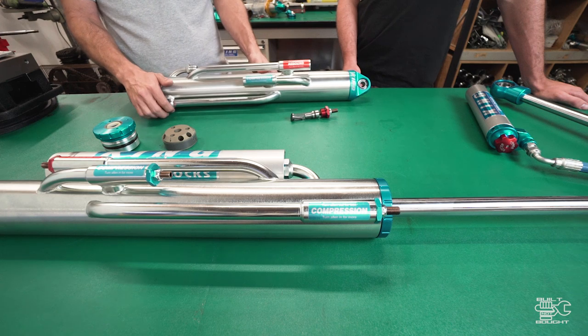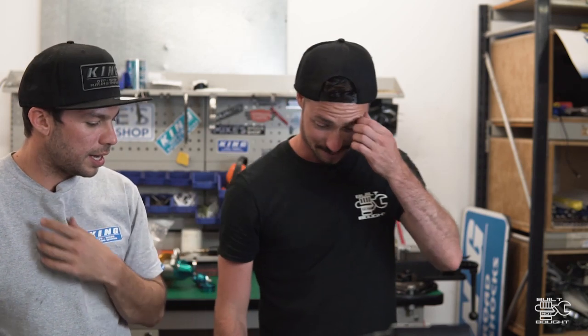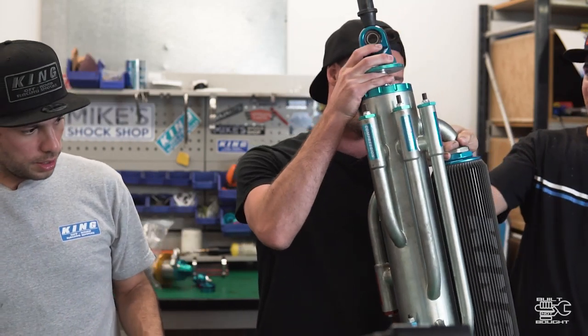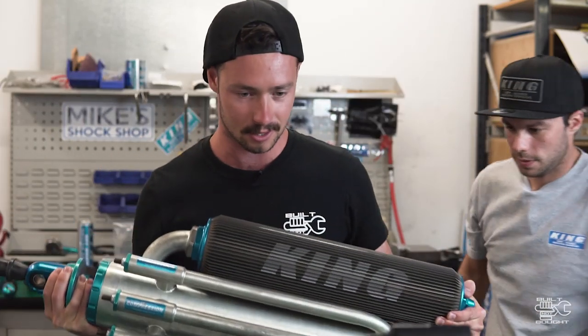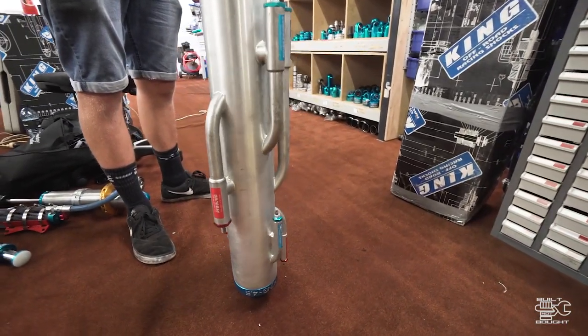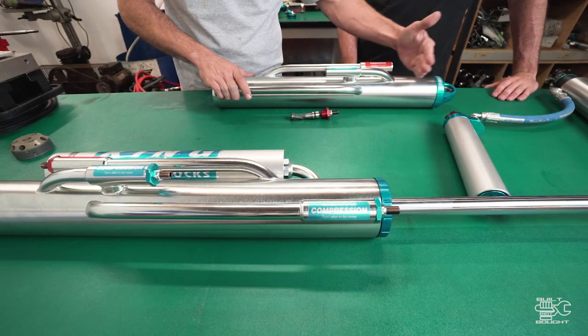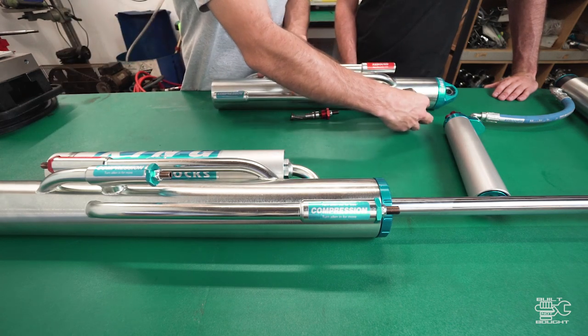As you saw in the IBP, it had a bleed-off zone then almost an internal bump zone - a two-stage shock absorber. These can come in two-tube, three-tube, four-tube, five-tube, all the way to seven-tube. The way these tubes work - they don't go the whole way up the shock absorber. You've got a compression tube that goes to here, which then stops, and then there's another compression tube. Essentially you can make it progressively stiffer. Up at the top you've got no bleed, so all the shimming on the piston is subject to going through that oil - that's what you call the bump zone. Once you get out here, this is the ride zone where it's doing most of the work.